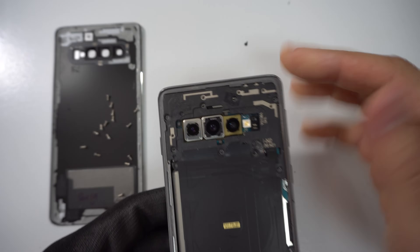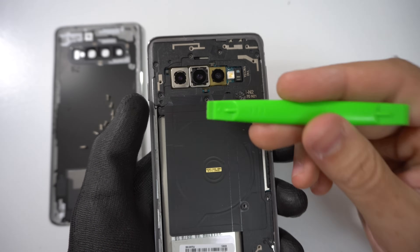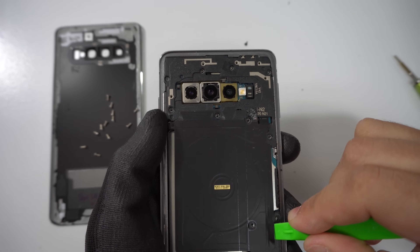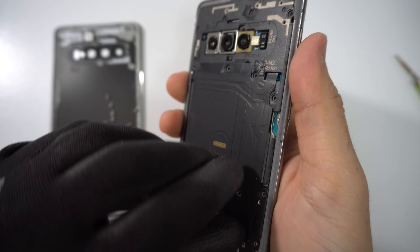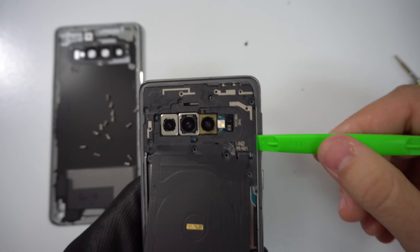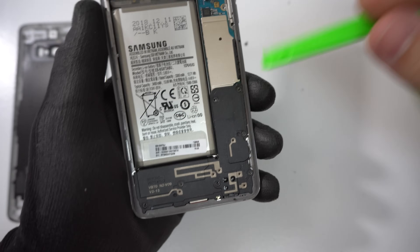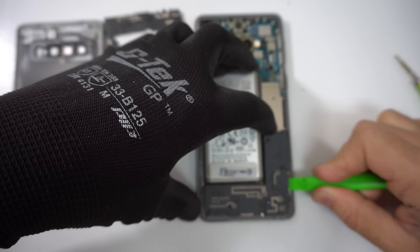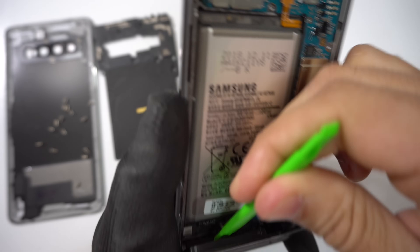Once all of the Phillips head screws are removed, we're going to be removing the back pieces of the phone. We're going to use the plastic prying tool and wedge it under the wireless charger cable — it's going to be glued down to the bottom speaker, so wedge under it gently and remove the adhesive by sliding in and lifting up gently. Then use the prying tool to lift up on the plastic portion of the back piece and the clips will release, coming off easily in one piece. Next is the bottom portion — the loudspeaker. Gently pry up with the plastic prying tool, giving it pressure slowly so you don't crack it, and it will release all the clips and come off easily.